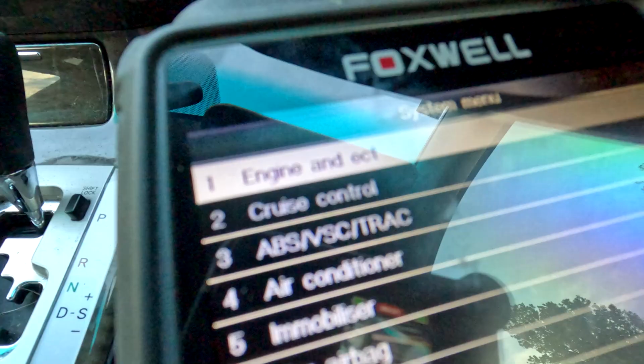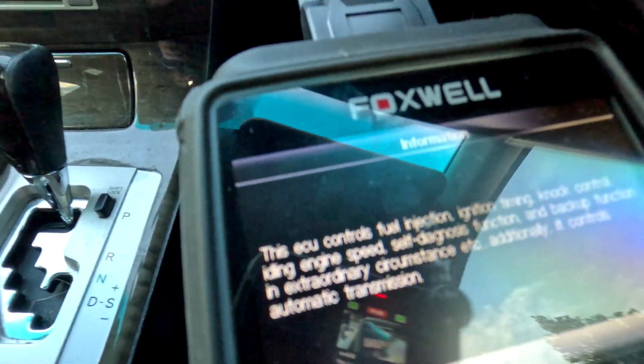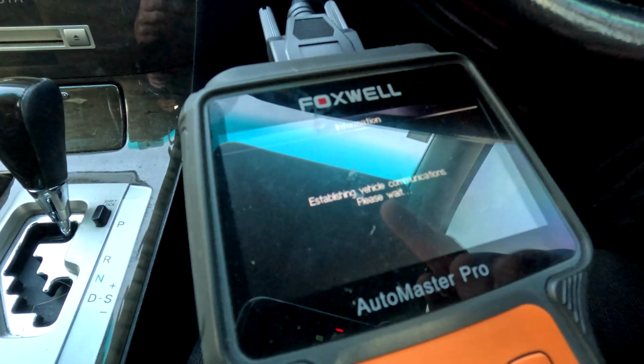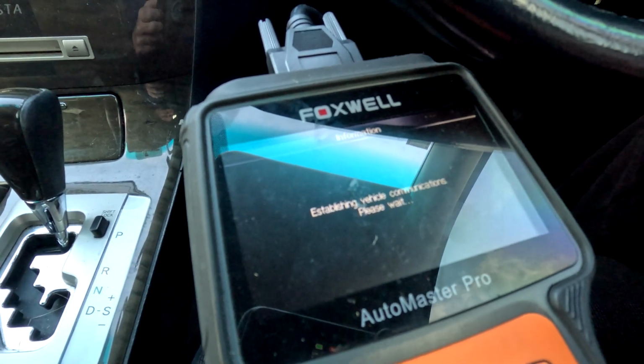The other thing I looked at is on my other scan tool, an LS430 has just a powertrain control module. On this little Foxwell, it's got an ECU and a TCU, or transmission and an engine module. So I am just seeing right now if I can look at the data as an engine and transmission, hopefully on this one. So I've attempted to go in, and we push OK, as a GS430, and it's going to say communication error. No communicating. That didn't work.